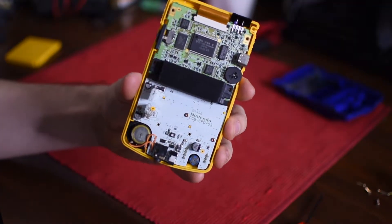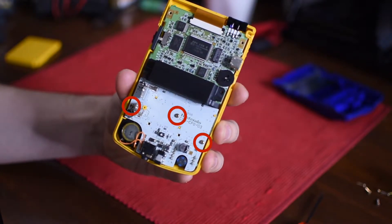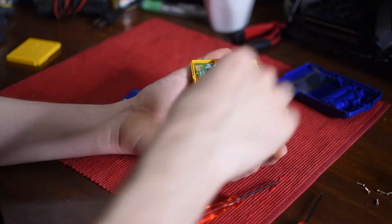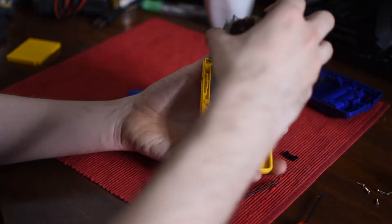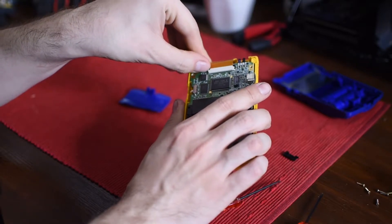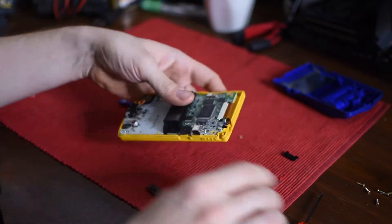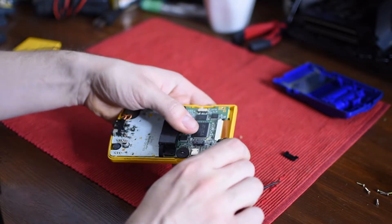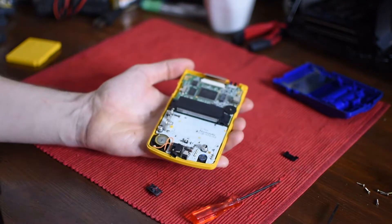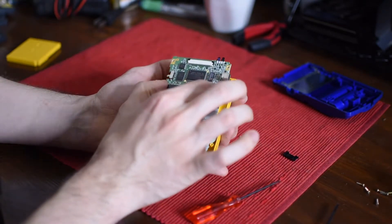When looking at the interior of the Game Boy Color, there are another three screws you'll need to remove, but these are actually star screws — you'll need a star screwdriver for those. At this point you're able to take out any of the buttons around the side, and you can even lift up and flip the board over — it's now only attached to the screen. To remove the screen, you just push up on the two little tabs next to the ribbon cable, then get a small screwdriver, put it underneath the cable, and gently force outwards to pop the cable right out. The board can then just lift right out.